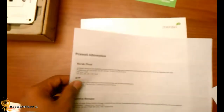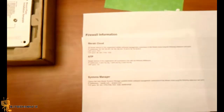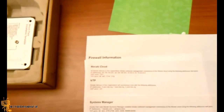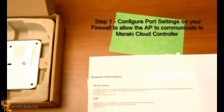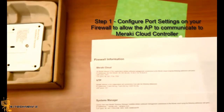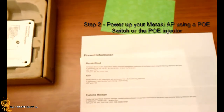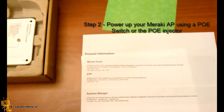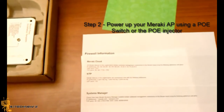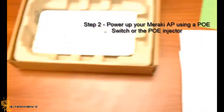Just keep in mind, there are firewall instructions that you need to follow. You do have to open up a couple of ports inside your network for this to work. The basic rundown: step one is installation and setup — read the attached port settings and make sure your firewall will allow the AP to communicate to the cloud controller. Step two, power your Meraki access point using a PoE injector provided, or power it directly to a PoE switch, which this is our PoE adapter, but most likely we're going to hook it up to our switch.